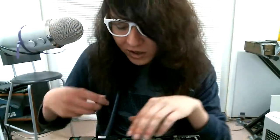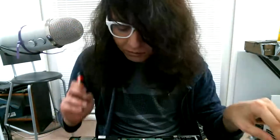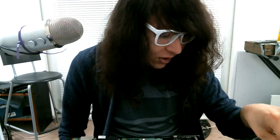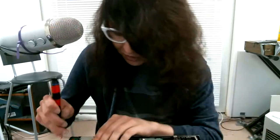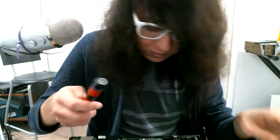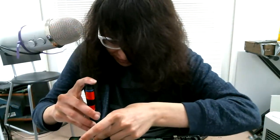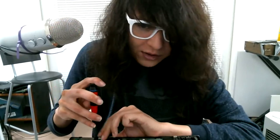I just ripped off the typefaces from 1995's release of Photoshop and then used ImageMagick on them. I installed Windows 98 SE on an IBM T42 motherboard stuck in a T43p chassis, which had a dead motherboard in it. It had the 1600 by 1200 IPS panel, which I quite enjoy. I think I might replace it with the 1400 by 1050 one I have and then put that 1600 by 1200 one in a T60 build.